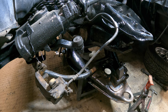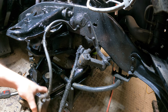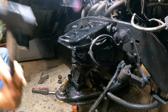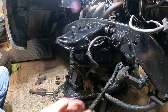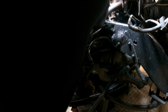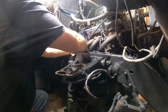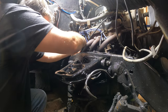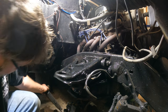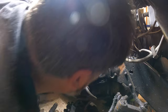Now we'll go to the other side - we're on a good roll, let's keep it going. We'll start by removing the ball joint. There we go. Shock or tie rod next? Do you think we'll get lucky this time? I doubt it, but you never know. Bolt out, shock out - that easy, lemon squeezy. I can see some more frame cleanup I have to do here before we can put it back together. Look at that piece - this piece is going to fall off. We'll get it cleaned up though. So now what we've got to do - tie rod.